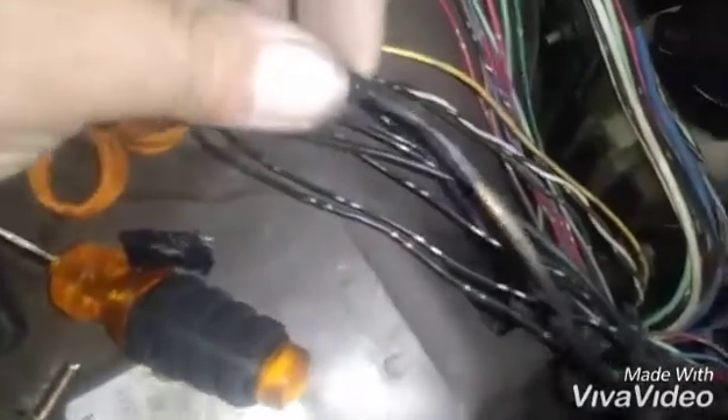We took a look at the CAN network and took some measurements. We found some wires that were not having a good connection. On inspection, we found this ground wire was melted inside the harness, and along the way it had taken out two very important wires — the CAN High and CAN Low — which is why there was no communication.